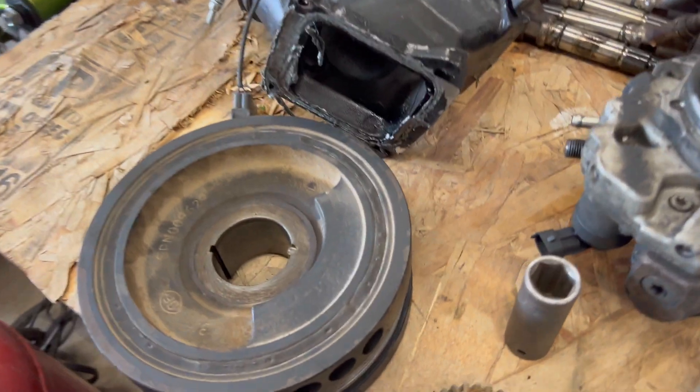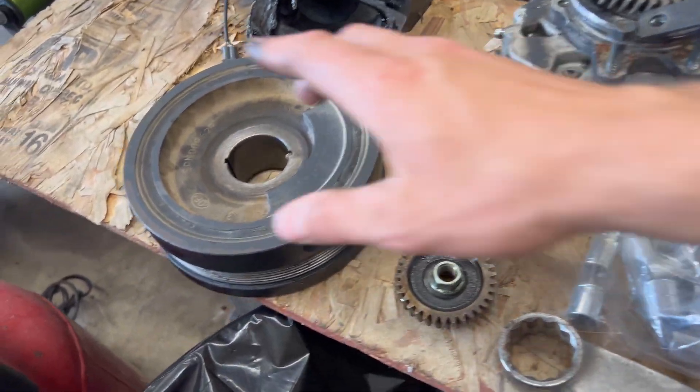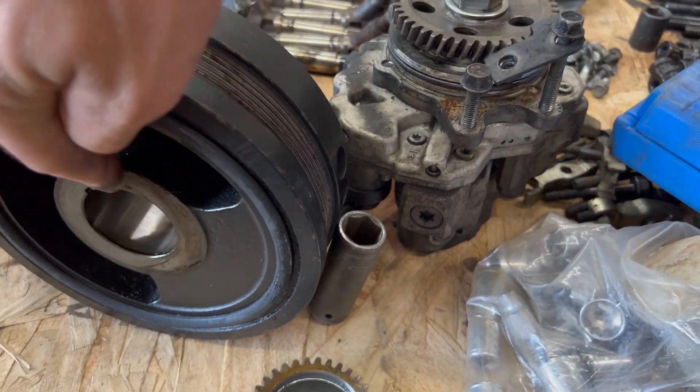When doing a water pump or removing the balancer, buy a new bolt. When you install that new bolt, don't just slam it in with an impact — tighten it to the correct torque spec. I know not everyone has a 250 ft-lb torque wrench, but they're available at AutoZone or O'Reilly's. For extra assurance, if you don't have a keyed crank, you can put red Loctite on the inside of the harmonic balancer and on the back side. Make sure the surface is clean — if there's oil on it, there's a much higher chance of it spinning.